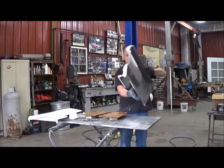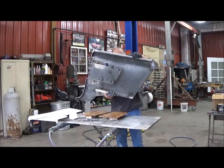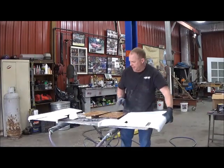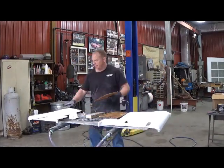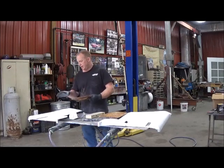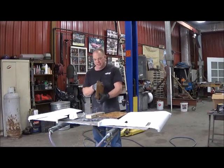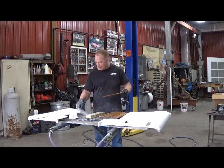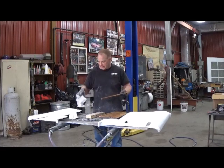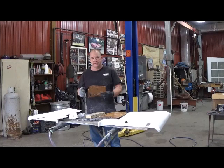But this one, same way, I got my metal plate in there for my trim bezel for the seat belt. And then my inner pieces, the inner panels, these will be done in the black stitched leather. These will be the seat insert color, the fabric that goes in there. And these are just those little thin panels, and I always wrap them in this real lightweight mat. It's actually for model car, airplane stuff.